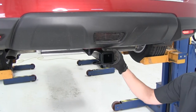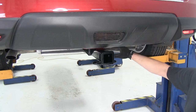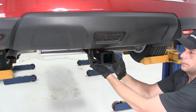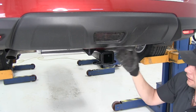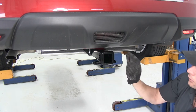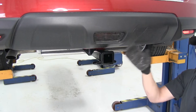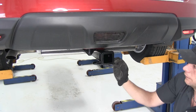Here's what the hitch is going to look like once you get it installed on your vehicle. It's really nice and tucked away. Your main tube is up here on both sides where you really can't see it. The only thing that's going to be out behind your vehicle is going to be your main receiver tube. It's pretty compact and they've extended it out enough to where you'll be able to use a lot of accessories. One of the downfalls to some of the other hitches on previous years in different Rogues is that the shaft is a little bit shorter and a lot of the accessories didn't want to fit, but they've extended that to help out with that quite a bit.